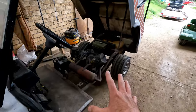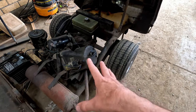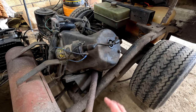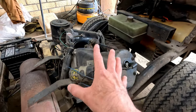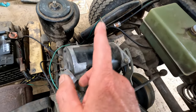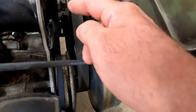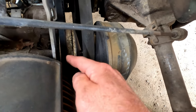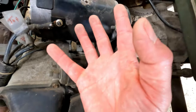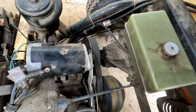So these came with, I believe, around a 70cc two-stroke motor. I'm not exactly sure on the motor size, but I think it was somewhere between 65 and 70 cc's. Two-stroke hybrid. Now, as you can see here, this has this massive electric motor on the top that serves two purposes. One, it works as the starter. When you hit the gas, you see here it's connected to the crank via this belt, which helps spin the engine over to get it running, and it also provides a little bit of assistance in driving it itself. So that's a pretty neat feature.